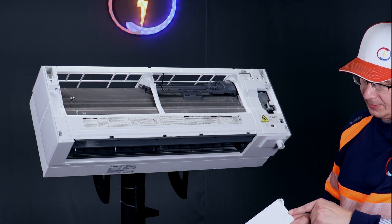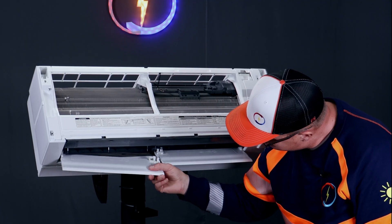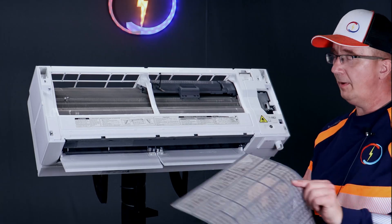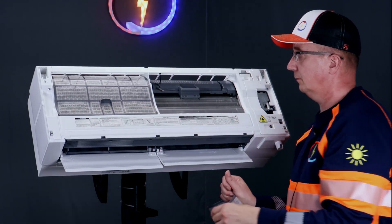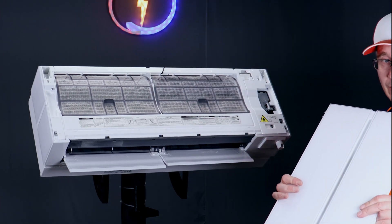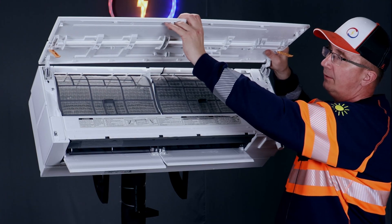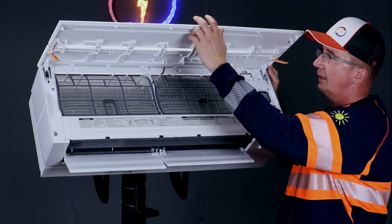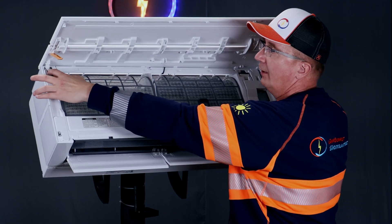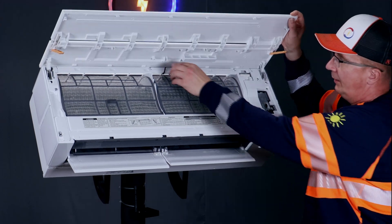Take this flap — there's a marking for the right side, so it goes on the right side. Slide the left side first, then slide it on and clip it on. Ozonator filter. Main filters. What's left is the front blade — this is not so simple to put back on. First put it almost at its base, then press it with a tool or your finger. You can hear the loud clip when it's on. Then don't forget the hook.